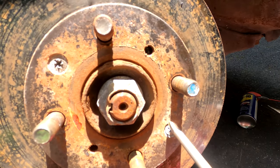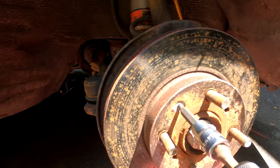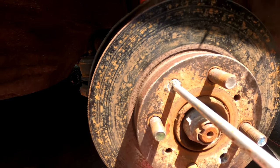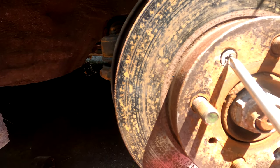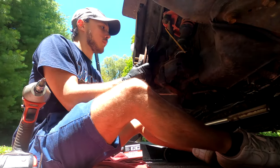You can see the screw was starting to strip itself, which is exactly why you then go in with the hand tool and very gently take it out. Apply a lot of pressure but be gentle - that's how you avoid breaking things. When I was young and learning to work on cars, I made many mistakes like that. Just be very gentle, and make sure you note which screw came from which side so you put everything back the way it came off.